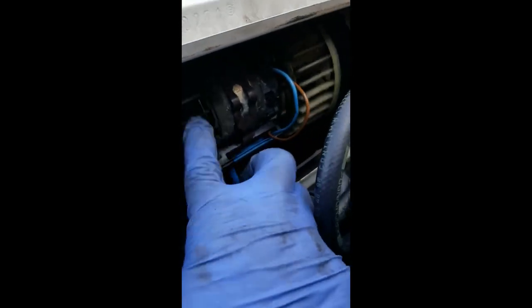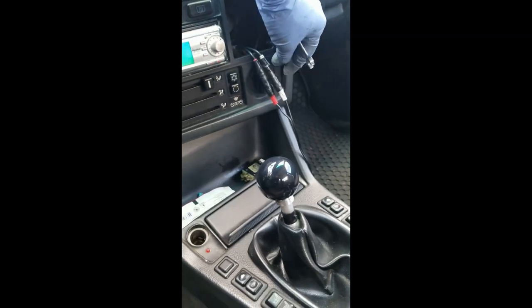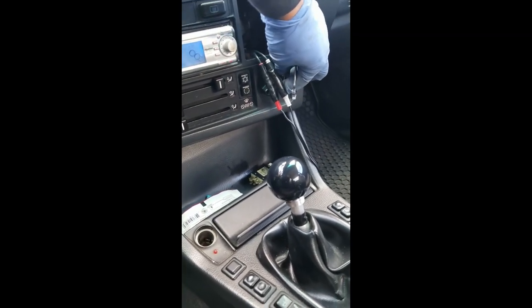See — spinning it, I don't hear the squeak anymore. That's all I had to do. I don't hear anything. So it's going to be nice and quiet. All I had to do was put a little bit of WD-40 right where the wheel meets. I'm going to turn on the blower motor. See the blower motor — nice and quiet. It's not squeaking anymore.